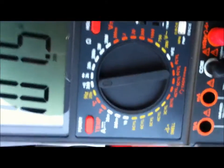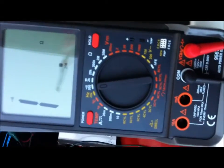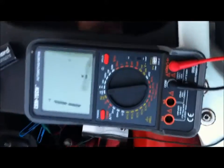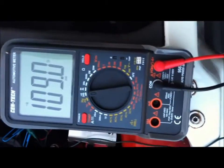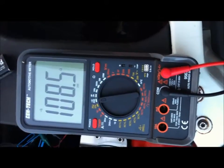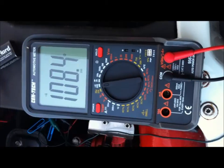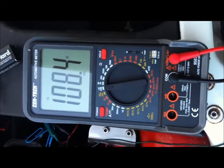At 25 right now, sitting on the magnet it goes back — you'll see it goes — once it comes off it goes to 1. One is going to be my infinite because I took it off, and at 1 that's infinite. So when I hit the magnet, looking at about 1.79, after it settles 1.8. This is on the green wire which is going to be my PTO.